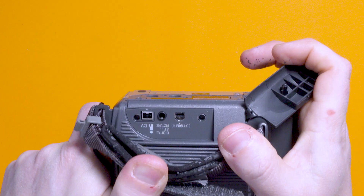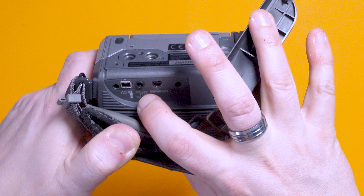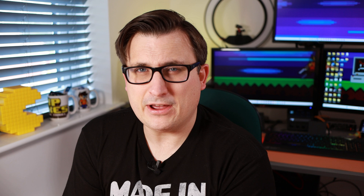Under here are some additional ports: an Edit E mini port, a digital still picture port, and also a DV port - that I do know. That is called a Firewire port. This is almost like a precursor to fast USB transfer. USB was around at the time but couldn't transfer data quickly. Firewire was a cable specification that Apple used back then for transferring data - very, very quick. Lots of Apple computers came with Firewire connectors, and PCs could too. Most modern PCs don't come with it because it's a slightly defunct system now.